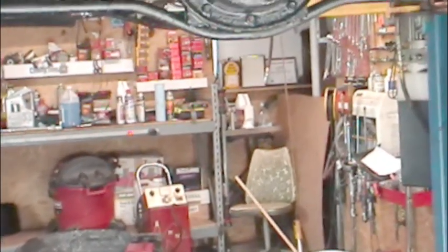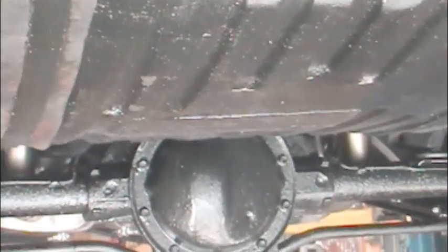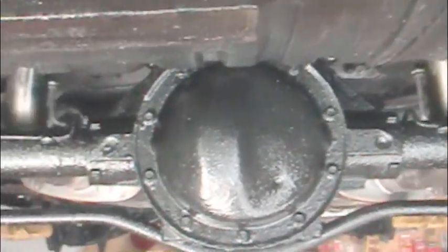With the proper equipment, if you're doing it on the ground it's the same basic premise — some bottle jacks and careful placement of props on the floor and long horizontal 2x8s or 2x6s for a nice wide bearing surface. In other words, pick up the whole area instead of a focal point like at the end of a stud. Have a prop on the end of that stud. With everything else and some jacks you too can change the pucks. Okay, there it is — thank you for watching. Please don't forget to rate and comment. Stay good, take care.